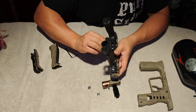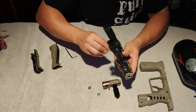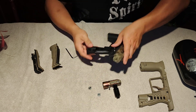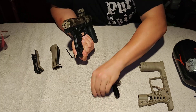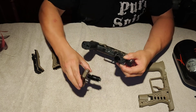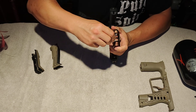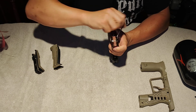Not overly tight, but they need to be tight enough to seal against the body. Once that's done, you can install the nuts for the ASA, one on each side. You might want to hold them in place so they don't fall out as you're doing this. Install the regulator and the ASA — I already have the air transfer tube installed. Snug these down, both sides evenly, and then you can tighten them up from there.